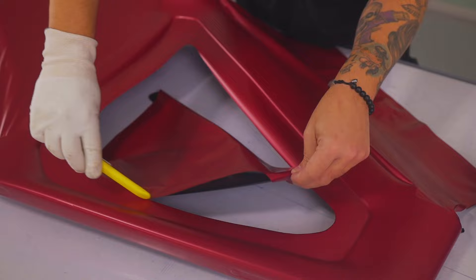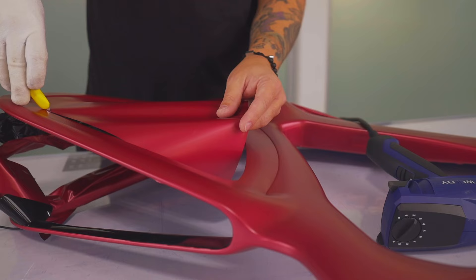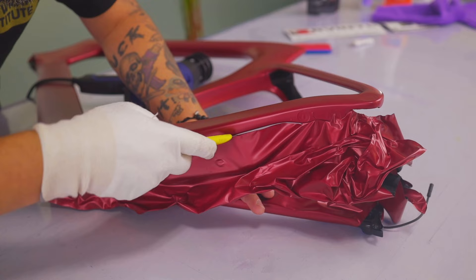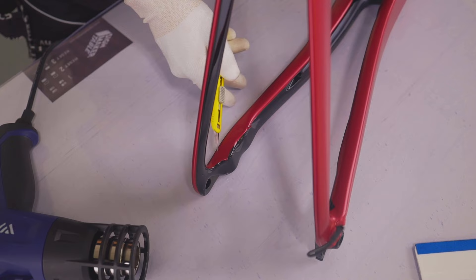Focus on the front first, then evenly stretch the film around the frame. Form the film to the other side so the material overlaps on the inside portion of the frame — this creates a very strong hold and the chance of it separating is very small. The overlap edges disappear into the body lines. Float cut this section so it wraps around as well, creating another strong overlap for good long-term hold. The excess film is overlapped, then cut away on the opposite side with the blade running next to the frame, not on it, and immediately sealed.